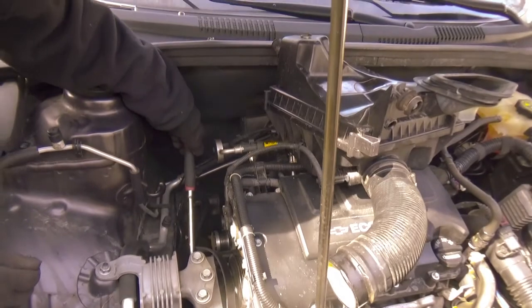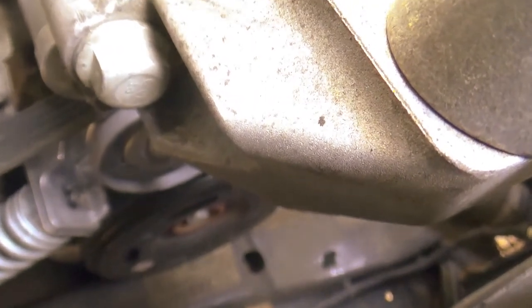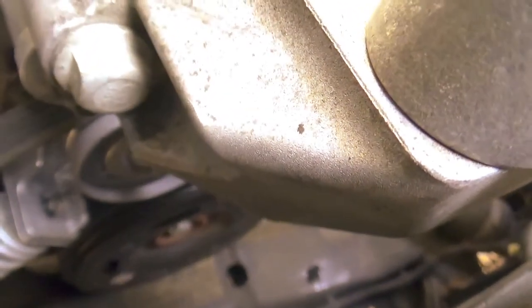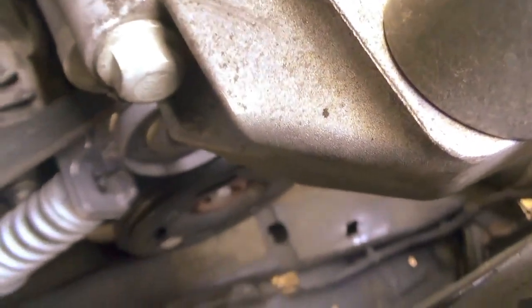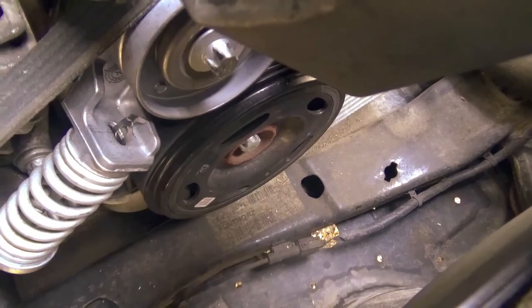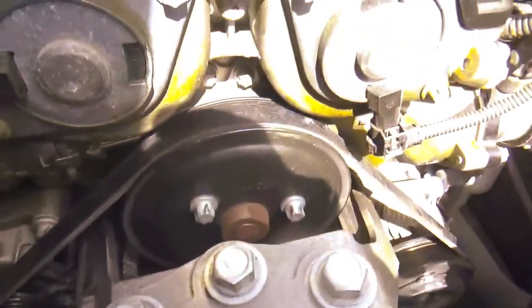I have to turn that off for a second. Where's the damn button? This thing right here. All right, we're back. I needed a couple more hands. That was pretty crazy. You should actually take the motor mount off and not try to go around it like I did, because it did take like 5 more minutes and 2 extra hands. But show you what I got. Right where it goes up around the tensioner, it doesn't clear unless that tensioner is pulled on fully, to where you can get the belt on it, because otherwise the motor mount is in the way. That's why I needed the extra hands to turn off the camera. But it's on there, it's tensioned, the clip's on there, it's not over tensioning and stretching the belt too far now. So see if we fix the squeaking problem. I think it was just way over tensioning.